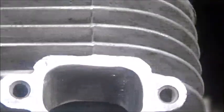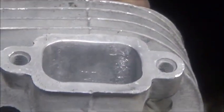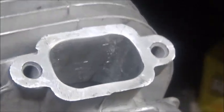Hey guys, we are here on Simple Man's 026 from scratch. I just got the port work finished on it. I've honestly been working on it off and on for about 3 nights, just trying to get everything as perfect as I can. The only thing I'll really say about this top end is that squish is really good on it with a gasket,